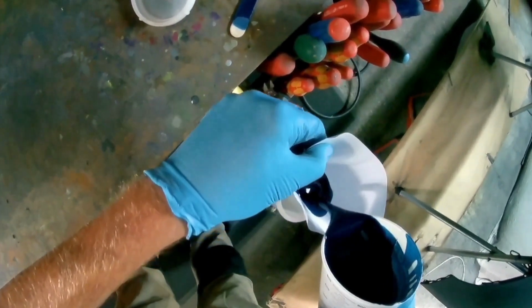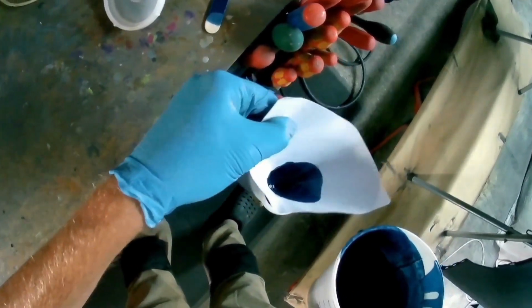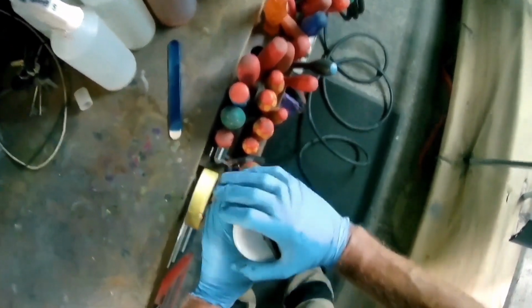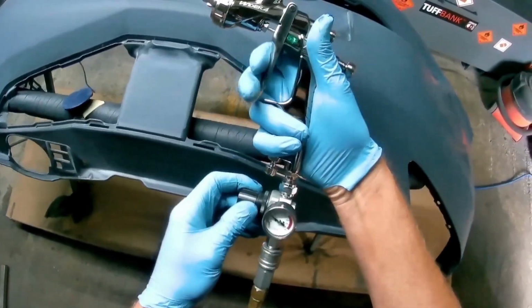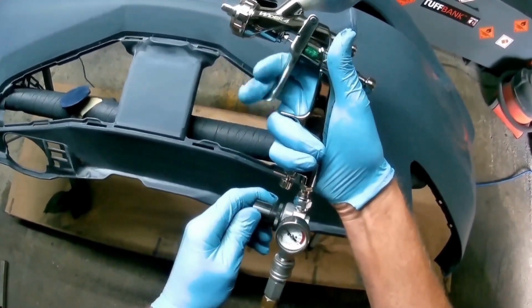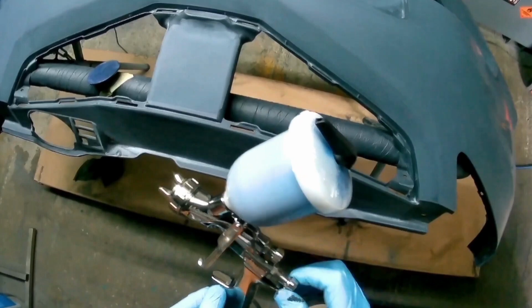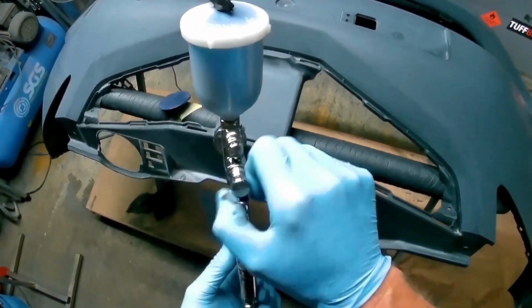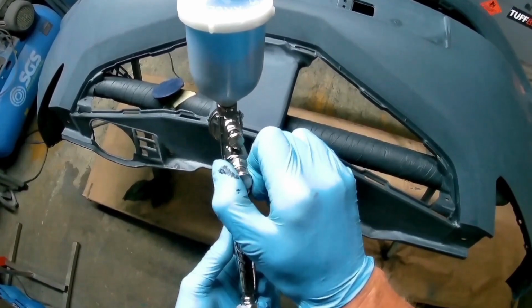For people that like, well, I keep saying I&O these days because of what SATA did, I suppose, with their I&O versions. If you prefer an O pattern to an I pattern, then this will suit you better, I think, than a Kiwami 4. The Kiwami 4 is a really good gun, especially value for money wise, and as I was saying in the introduction, these things are actually the same price or thereabouts. So there's no saving to be made by going for a Kiwami 4 or a Wider4, as long as you don't go for the L version, which, as I said, is quite a bit more money. So the standard Wider4, as I say, gives a much wetter pattern. Today we're using it for base coat. It's a bumper, or fender, as you say in the US.